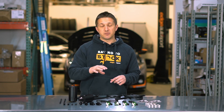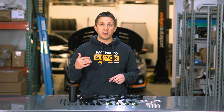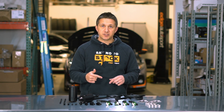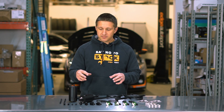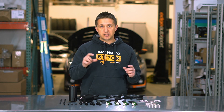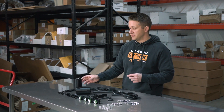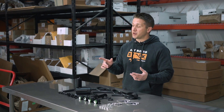There are two places where crankcase vapors get recycled back into the intake. One is through the PCV, which on the Type R is a built-in PCV valve on the valve cover — that gets recirculated back into the intake. The other is the crankcase ventilation, which goes into the intake tube. Each one of the cans catches the vapors and blow-by from each of those spots.